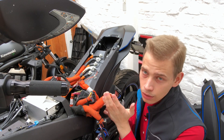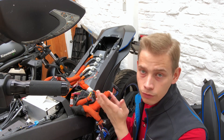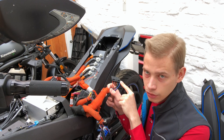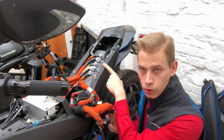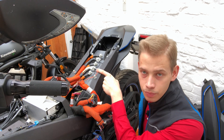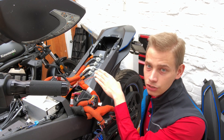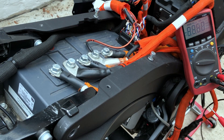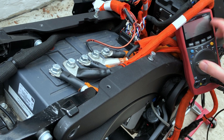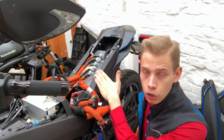Next, it might be possible that there is no voltage on the system, but we should check. So we get our voltage meter and check all the pins against each other to see if there is any voltage on them. We do the same with the motor controller — in the top is our positive terminal and lower down here is our negative. As with the small plug, we check all pins against each other. We should only start working if we are in a voltage range below 10 volts.